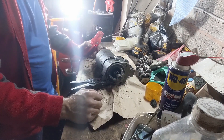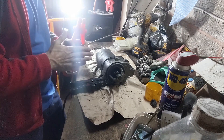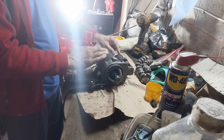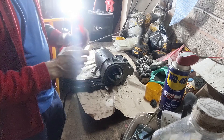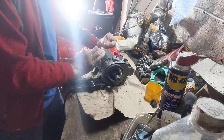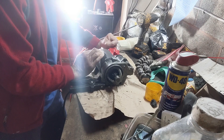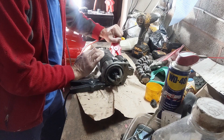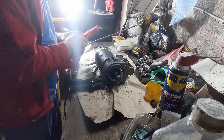We're back for part two. I heard some helpful comments on how to test some of this. The first tip is we can test the starter motor to see if it's the solenoid that's the issue by putting power across the two terminals. This won't actuate the lever, but it should get the motor spinning. And it does — it just needs power on this one terminal. So we know the starter motor works.